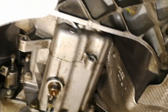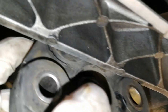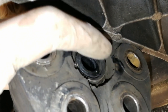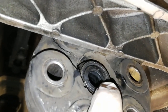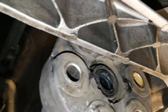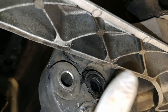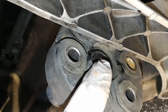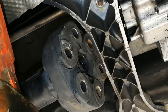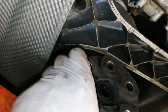Here you can see there's a centering pin on the drive flange of the transmission that slots into the driveshaft, and there's a bearing or bushing that slides onto that pin — this is what keeps the driveshaft centered. It's a good idea to replace this, but I don't have the part, so I'll clean it out, put some grease in there, and reuse it. With the driveshaft slightly bent, I gain some space and can finally remove the flex disc.